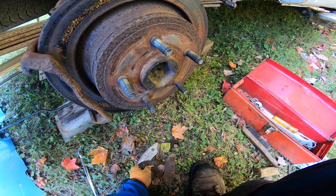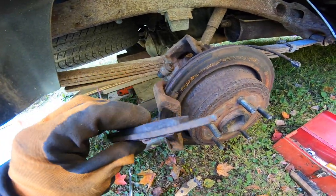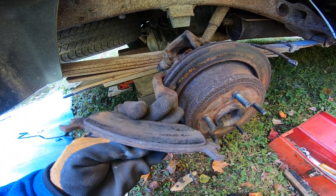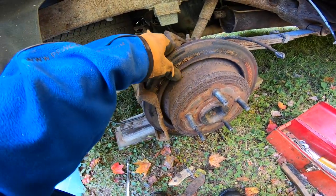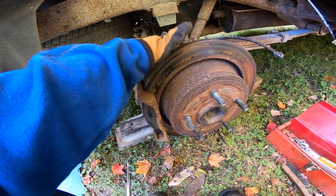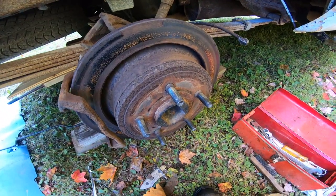But you see, the same thing happened to my Ford. Once your caliper jams up, this caliper is the only thing stopping your vehicle. See, it's like a quarter pad there. You know what I mean? Not going to reuse it. I'll put on new ones. I know they say not to do it, but you know, it's a $40 fix that'll get me till spring. New pads are definitely not going to be as bad as these old pads.